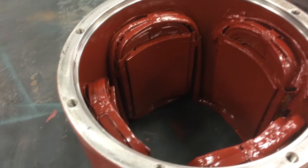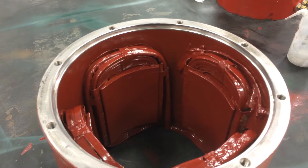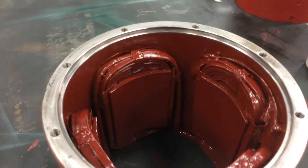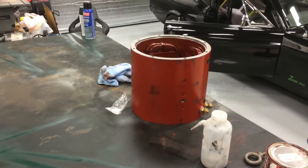That'll help prevent any kind of flashover. When we hit 174 miles an hour, we actually had some flashover inside the motor — essentially think of a lightning bolt trying to burn through the windings. This should help prevent that at those unbelievable voltages and power levels. That's where we are.